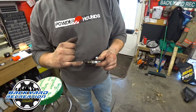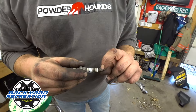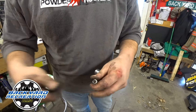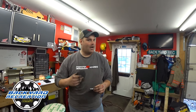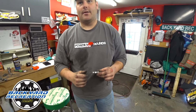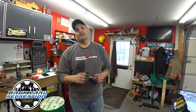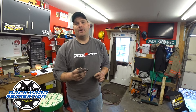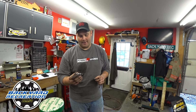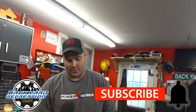Your electrode may be okay — this one's starting to burn — but what you're really going to find is your boot is actually burning in the tip of your plug. So when your plug's on there and your boot's on there, this thing's starting to arc through there. Over time, it starts building a hole in your plug, which leads to not-so-good contact, which leads to not starting. So plugs may be good for 10,000K, but get these things changed. Get them looked at — that's what you're looking for.